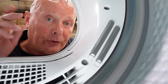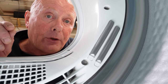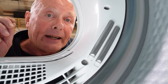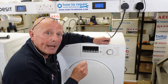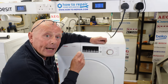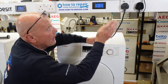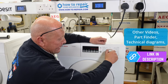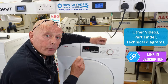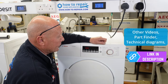What this person asked on the YouTube comment was how to actually test the heating element. Let's go around the back of the machine and I'll show you the two thermostats, the NTC sensor, and how to test the element. Before we take the back off, I wanted to show you quickly how to test these properly using a portable amperage meter that only costs 10 to 15 pounds. If we turn it on to timed program cold, you will only see the wattage and amperage being drawn for the motor.